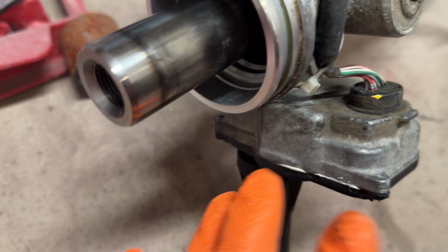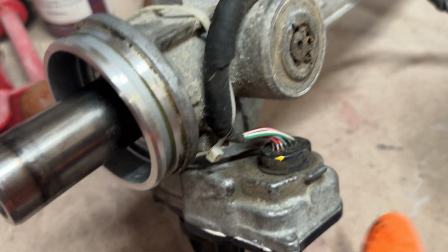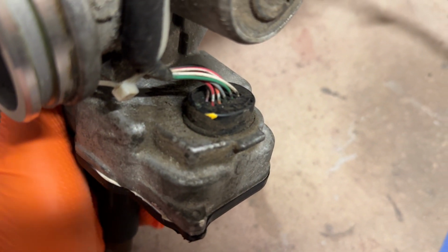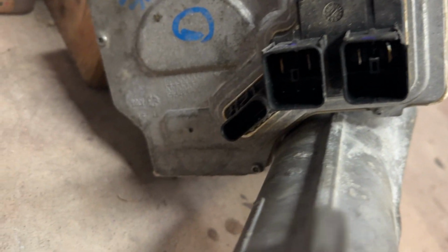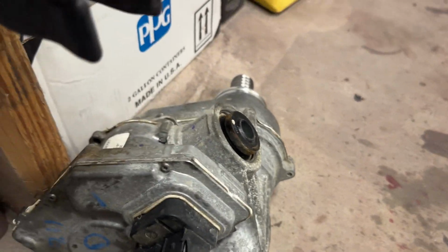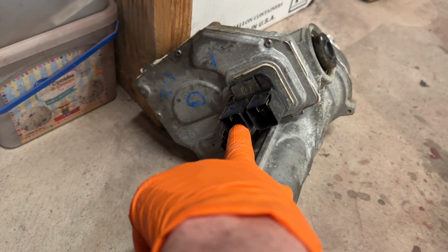So what I imagine happens is this module here senses what the driver is doing with the steering wheel and sends that over these wires and into that pin, and then it takes the data from this other module that is sensing what the driver is doing with the steering wheel, combines it with what's coming over CAN bus for the ADAS, Advanced Driver Assist System CAN bus signals, and makes a decision on how much torque to apply to the motor in what direction. And so far, all of our efforts with the comma are focused on the CAN bus data that comes in right here.